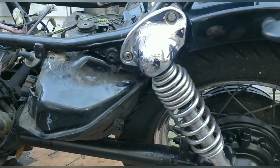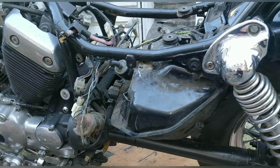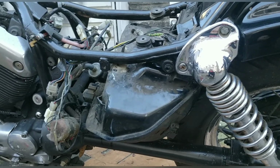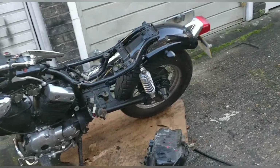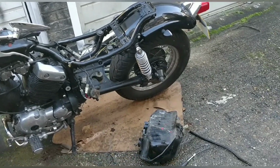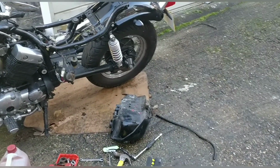This is a mini restoration here. We want every wire we see and approach to be sprayed with contact cleaner, and we want the tank to be fully cleaned. We want a brand new fuel filter on there so it has 10 more years in it, or 5 more years in it. You know, we want to do this properly. Alright guys, that was exactly what had to be done. So you loosen it all up, you undo the rear shocks, you lift it, somebody else teases it out. That was the only way to do it. I'm going to go and give this a rinse out, see what we're working with. If it needs another 24 hours, then that's exactly what we'll do. We'll put it back in for another 24 hours.